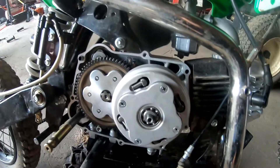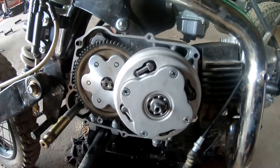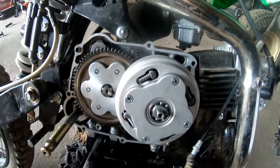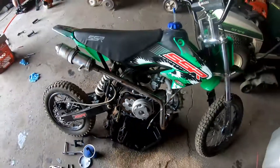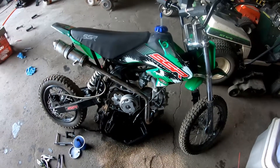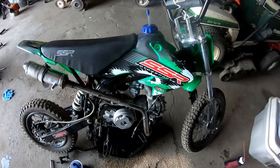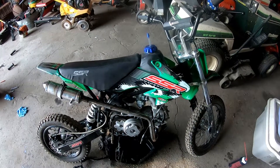We cleaned up the gasket surface on both the cover and the engine, so it's basically just ready for a new gasket. Then we've got to put the brake lever back on and all that stuff. Hopefully if you ever had this issue — if the bike sat for a while and there was gas in the oil — that's definitely not good and the clutch plates will get stuck together. We put it all back together and it should work. I'm thinking the clutch wasn't burnt out because it didn't slip at all, so we shall see when we get some oil on it. I'll finish up with a part two after we get that gasket, then we'll try it out, adjust the clutch, and see how it goes. Until then, this is going to be the first part of the video — we'll see you guys in the next one.